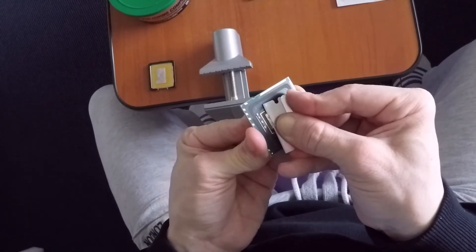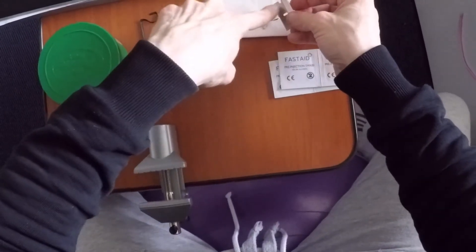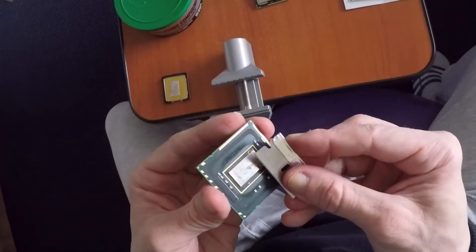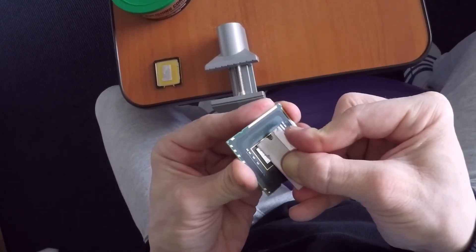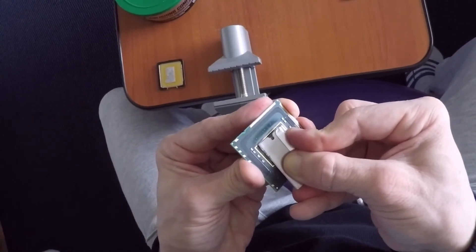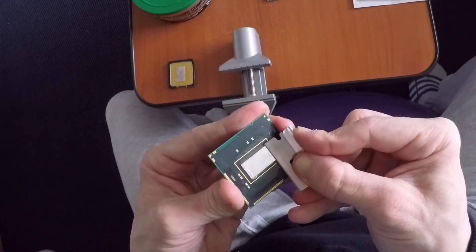Still not using any heat, to prevent damage — if you heat and then cool the CPU, you're going to damage it. As you saw, the vice was not used with heavy force, and pre-cutting the gasket makes sure you're not putting any additional pressure on the core itself. There you have it: the gasket is cleaned and the excess thermal paste is cleaned.